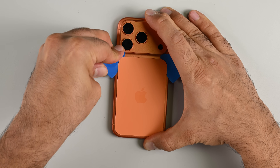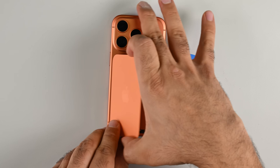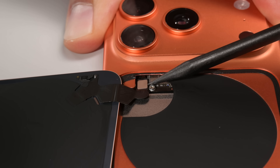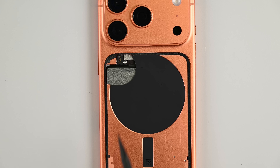A small bracket secures the wireless charging cable. Once that's disconnected, the rear panel lifts free. Just as I feared, goodbye to the dual-entry design that lets us do most repairs by lifting the back glass. The back glass is a ceramic composite which can shatter, so I'm glad it's easily replaceable. But otherwise, there's not much else to see here other than a glimpse of the metal-encased battery.